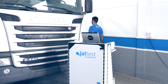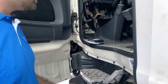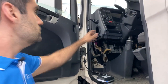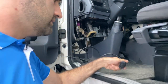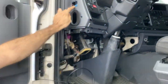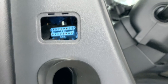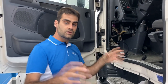At this point, I suggest checking what's going on with the OBD connector. Here we have the permanent blue LED on, which means the battery power supply is correct. But sometimes we've got a problem in the communication lines. As you can see, all the pins look correct — no bent pins. Let's take a closer look at the connector. Please take a look — the pins for the CAN lines are oversized. Pins 6 and 14 are completely oversized. This is a typical problem in some vehicles.